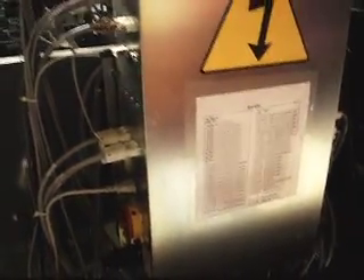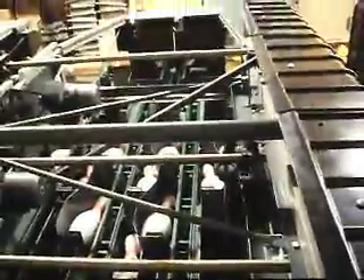In the past, I've shown you just where the tooth rack — the geared tooth rack on the table — is bouncing back and forth, and that'll keep the spotting tongs switch off of it, and I showed you how to adjust and check that. Another one I showed you in the past was where your spotting tongs will just be crossed underneath the table, but we got a new one here. I'm going to show it to you just so you'll know.